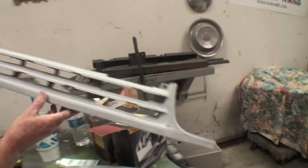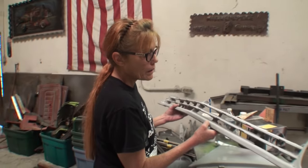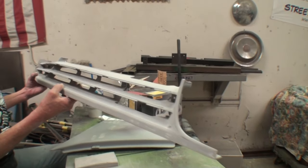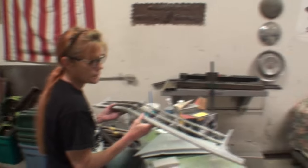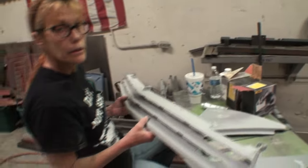Is that one ready to paint or just put a coat of sealer on it? That's Pete's call — he's the painter. I would put some sealer. What grit is that sanded to? Down to 180. So if we sanded it down to 320, we could probably go ahead and seal that and paint it — since we used polyester filler instead of bondo.